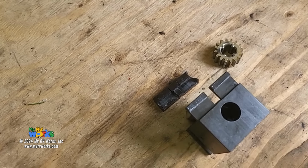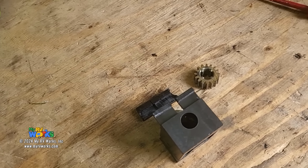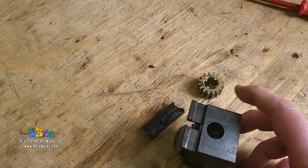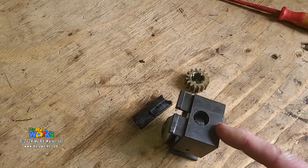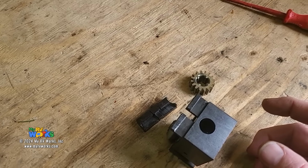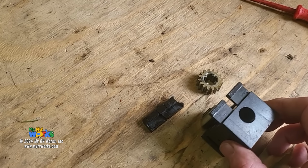And now this is where I'm gonna totally deviate from what the Lippert manufacturer is telling you. My position, and I've literally worked on hundreds and hundreds, maybe even thousands of these Schwintek systems out here in the field. Overwhelmingly, the bell curve of damage that's done to these systems is because it's not lubricated. It's dry. This is a mechanical component. I don't care how it's manufactured. This piece slides back and forth in that rack.